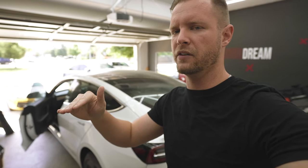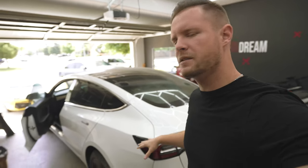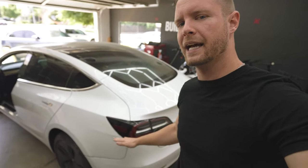The shop did a good eyeball job, but obviously it's not lined up perfectly. The repair that he shaped and all the holes that the brackets go into kind of didn't line up perfectly. So all that to say, I need to at some point add some more body filler and fill in that gap just a little bit and meet the panels up a little better.